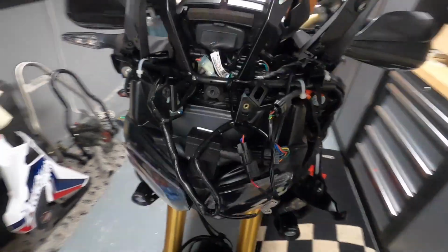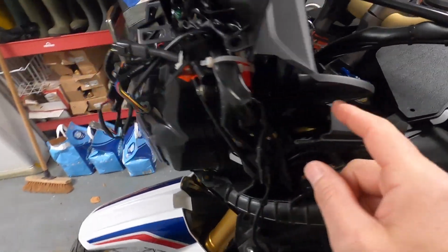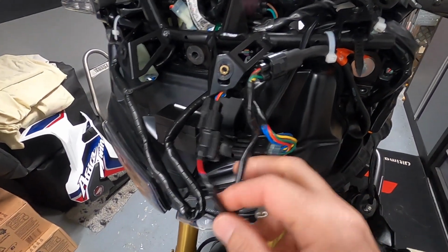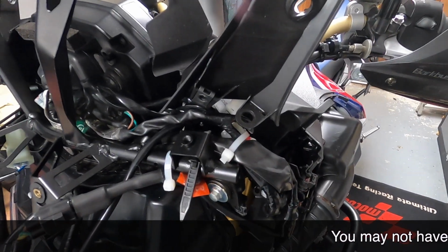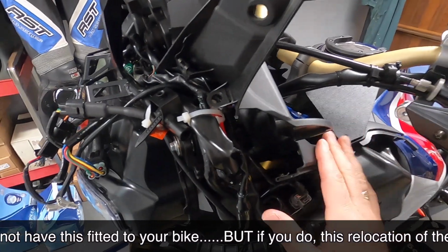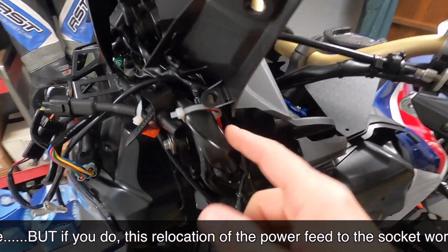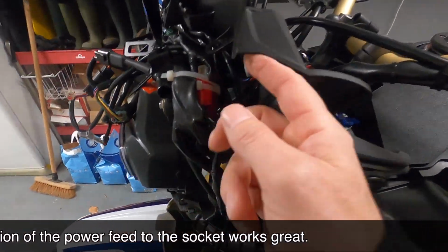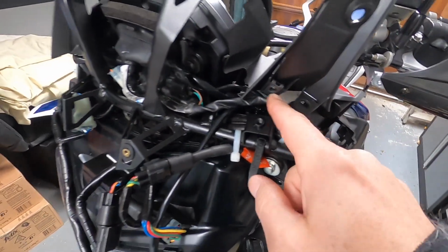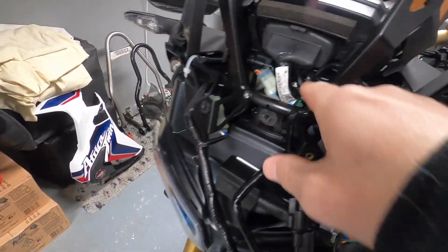The power socket, which I purchased, installed, I wired that myself, and there was no problem installing the fog light switch, which I've just taken the panel off here. You see the fog light switch, and then the power for the fog light switch is the blue and red cable here. And then obviously I've had to get power to the power socket down here, and all I've done is, with the fuse that comes with that, because it's the Honda OEM one, this is a 2017 model. Later ones, I think the wiring is a lot easier, and you didn't have this faff with the fuse being hidden out of the way. But basically all I've done is zip tied it to this main black cable here, and there's sufficient clearance, and there's no pressure on that, so that's not going to be a problem, and that shouldn't get wet either. So that's that white zip tie there, just keeping the supply to the external power socket nice and neat. And then obviously that cable then runs into some of the plug and play stuff down here.